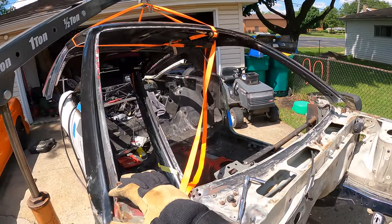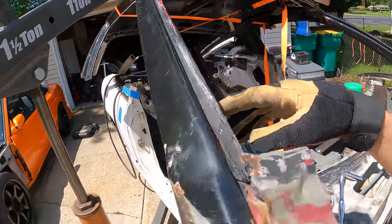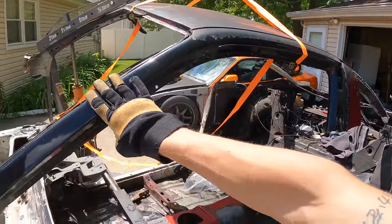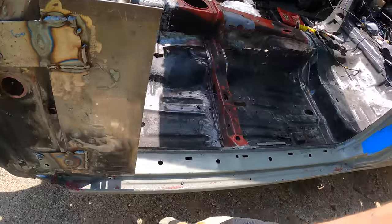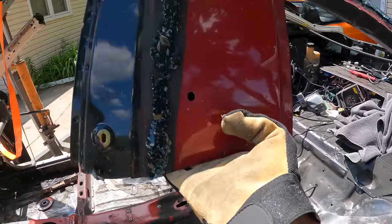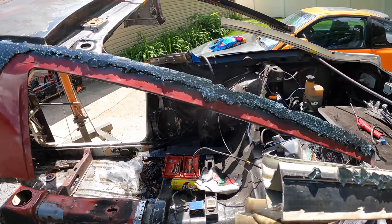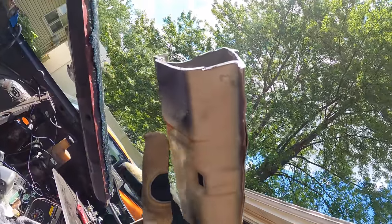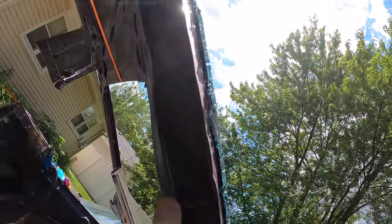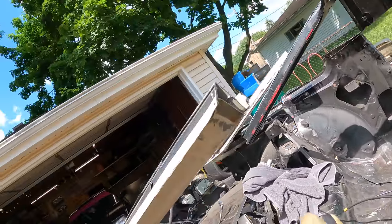As the roof is now, it's not going to sit on the car very nicely because we have two A-pillars on this side and two C-pillars on each side, so I need a game plan for each pillar. This is the easy side — since this roof was cut off the same car as this whole half cut, I know for a fact it's going to line up exactly. The B-pillar will line up too because that's the same car. For the C-pillar, I'm thinking of cutting it off at the spot welds, which will ensure that's the exact location where it has to be mounted. I'll do the same for the C-pillar on the other side.